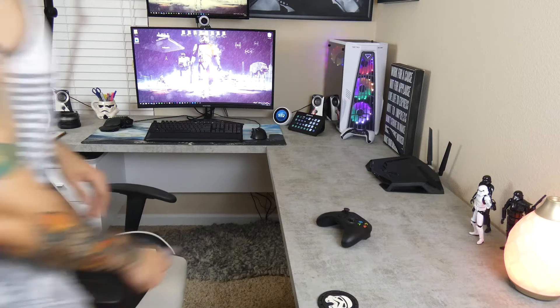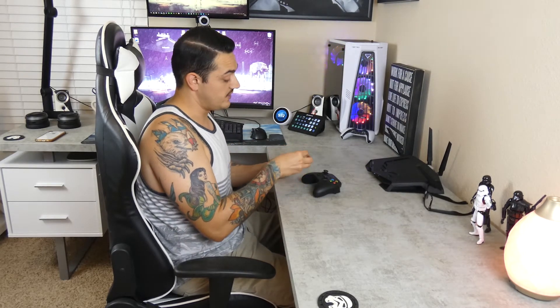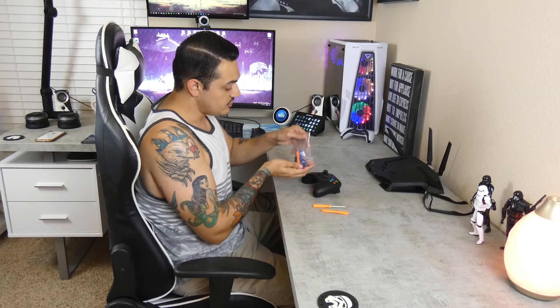We have our little workspace here at the Stormtrooper desktop. We have the new Xbox Series X controller and a little tool kit that I use to disassemble my controllers — I will have a link to this in the description below. It does make it substantially much easier. You will need a T8 and a T6 screwdriver, and some wedges and picks that help you break the shell apart.